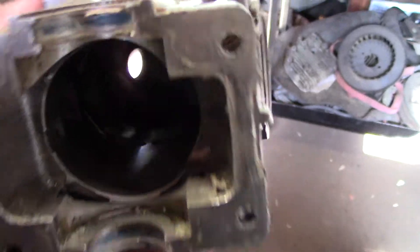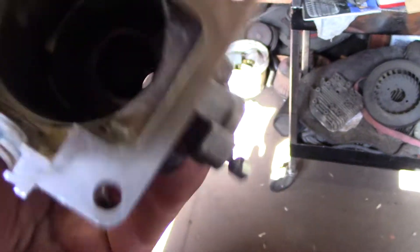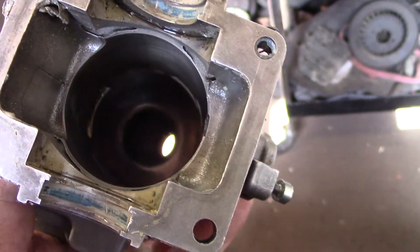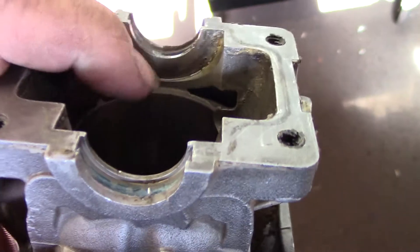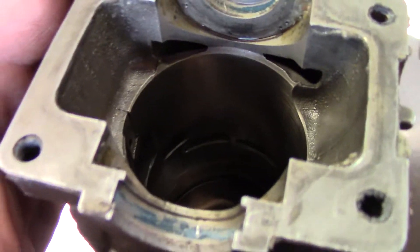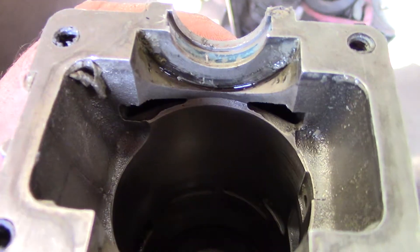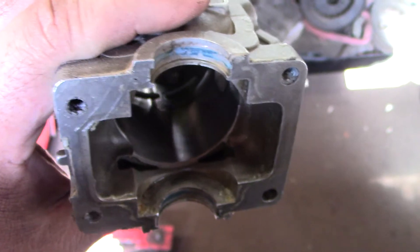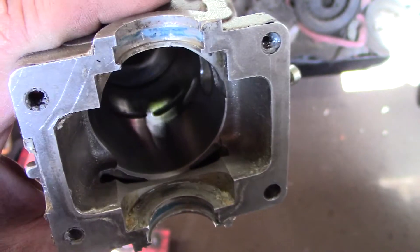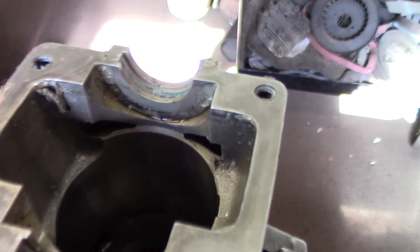Either get another cylinder or try to fix this one — that's where we're at. I'll try to open the port up more; maybe it'll help solve my problem. I don't want to mess with too much because the torque is beautiful and this saw is running right. You can pull logs with this thing — it's not the fastest saw in the world but it's got pull.